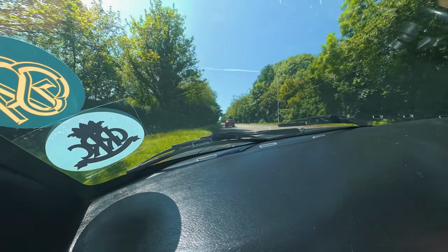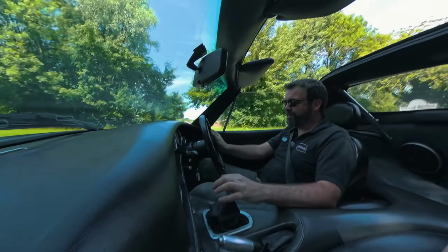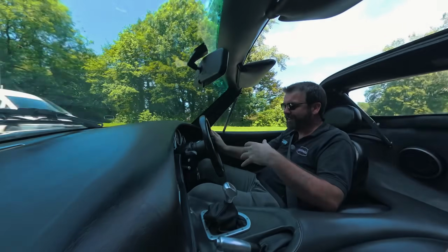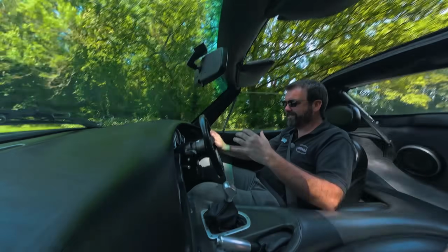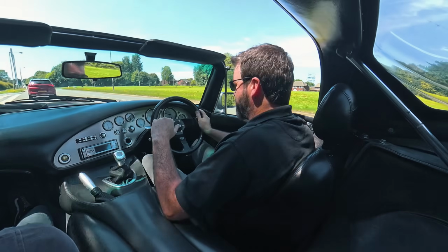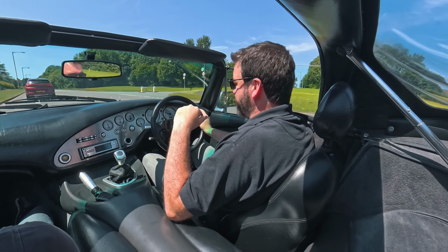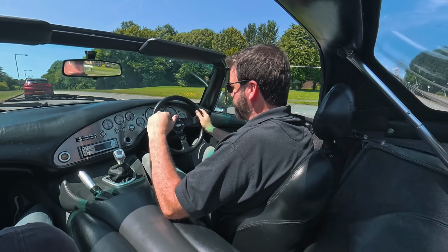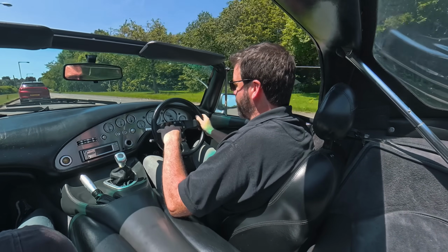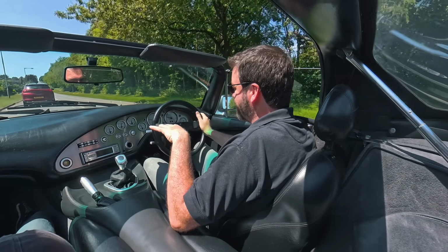Yeah. You don't then have to go really stiff on dampers and spring rates, so it keeps a bit of compliance, keeps a nice ride. It also allows you to put the power down better, because your rear end isn't really stiff. And we did a lot of work on the anti-roll bars as well, so this has got like a Tuscan style rear anti-roll bar, so it's the full width of the car rather than the original rear anti-roll bar that just operated on the inner pickup points on the wishbones that hardly did anything really.